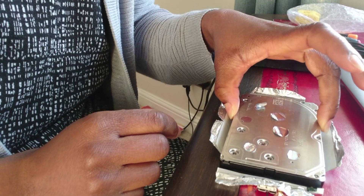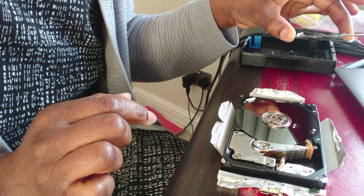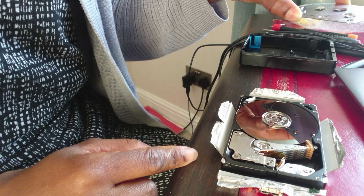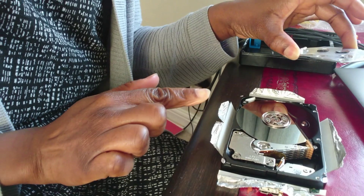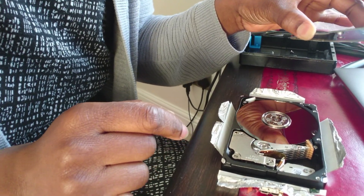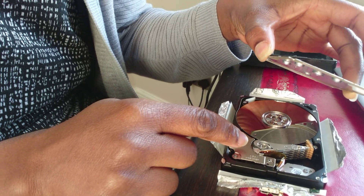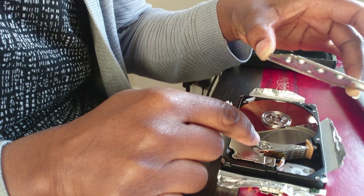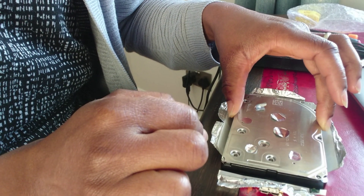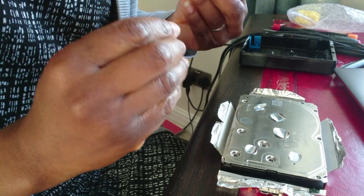This is what it looks like inside. You've got the discs there, and you've got the read-write head right there. I don't want to leave it open for too long because I'm still going to try and replace the head once I'm able to find where to get it from. This is the bit that's damaged on mine. I'm going to have to use a strong magnet to get this off, unscrew this, take it out, put something to stop the heads from touching, and replace it with one that is good.